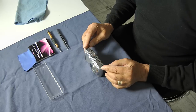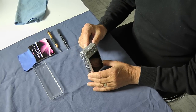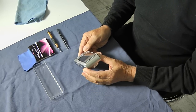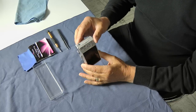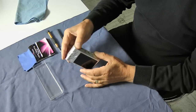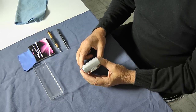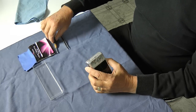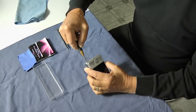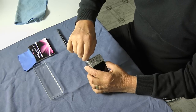Let's start by disassembling this camera — it's a TZ-10 which has got sensor problems with dust, and we need to remove the rear of the camera to gain access to the CCD block. To remove the TZ-10 rear case you need to remove two screws from the right-hand side, three screws from the base, and four screws from the left-hand side. To remove the screws it's just a simple matter of using your jeweler's screwdriver, pressing hard into the screw so you don't slip and damage the screw head, then undo the screw and place it into your container.